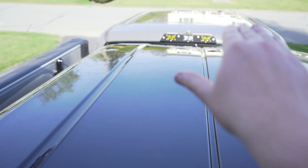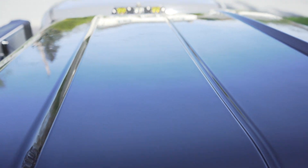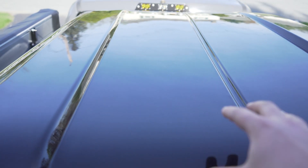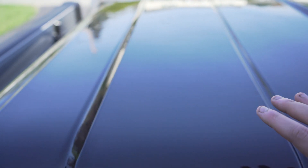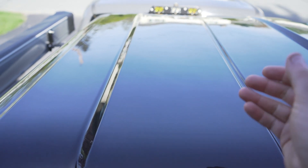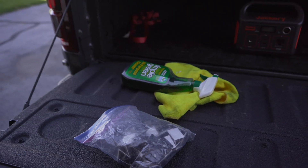I haven't really decided whether I want the connectors on the rear or towards the front. I think I want them towards the front because the tent tapers off more that way, so I can route the wires underneath the tent from the front and charge the Jackery whenever we need. Make sure you clean your surface pretty well — I've cleaned mine. I'm going to 3M adhesive the solar panel down using 3M double-sided tape. This is the location that Roof Nest generously designs into their hard-shell tents in case you want to mount a solar panel.